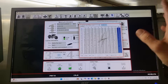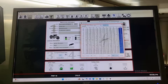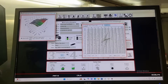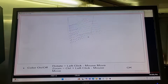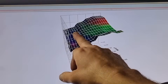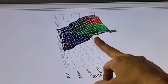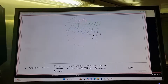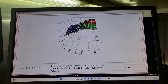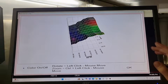Typically I'll set both columns 95 and 100 to the same, so when I'm tuning and you go down to sea level it's going to jump over there and the ECM will see the same thing — it's a blanket to cover all environments. If we look at this as a graph, you can see as you roll on there's a hole in the table right where you're sort of cruising. Then as you roll on there's a good amount of timing and then it falls over and kicks back up — it's very erratic, we don't want that.